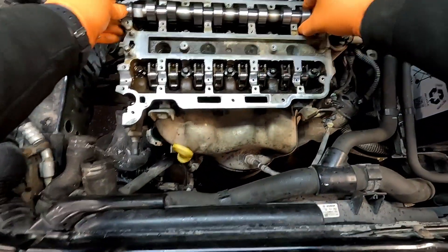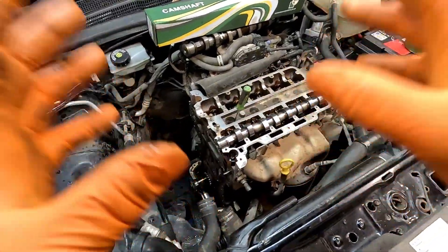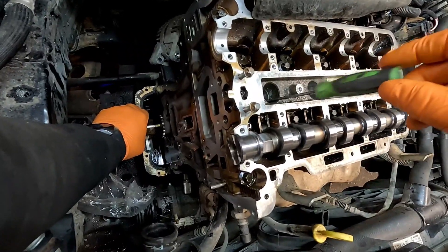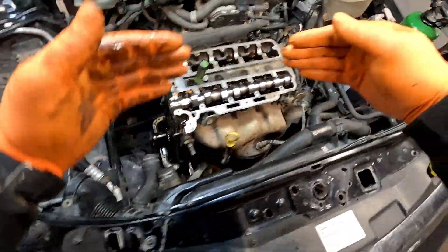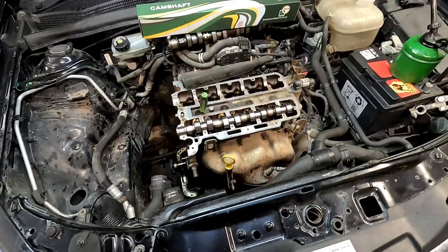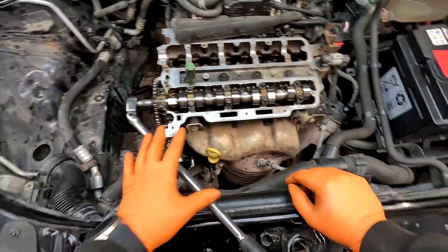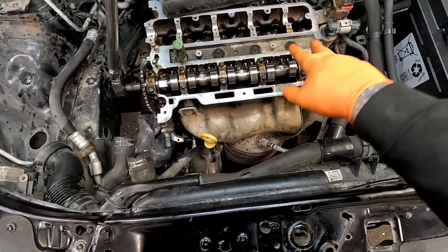Once we've done that, grab the camshaft, plunk it in place, and get the camshaft carrier caps on and tighten down. Before fitting the caps, pull the crank locking pin out a little bit, grab the crank and turn it until the pick needle goes down - we need those pistons halfway down the bore. That way, when we're tightening the camshaft, if the lobes are open and pushing valves down they won't damage the tops of the pistons. The caps are torqued down to 8 Newton metres. Then get on the ratchet and make sure that camshaft is turning freely and all the lifters and rockers are working as they should - turn it over as many times as you want to make sure everything is working correctly.